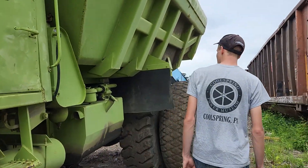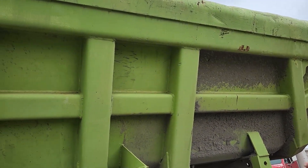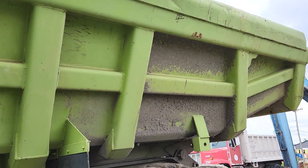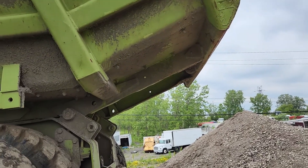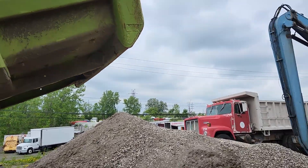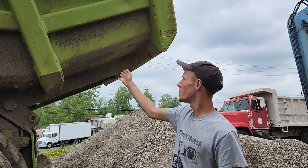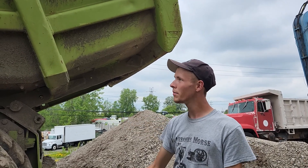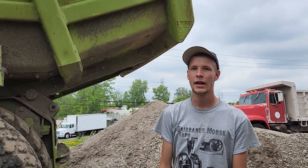When you come along the back, you can see your steel dump bed. It's got all these ribs attached there to help reinforce it. You can see that it goes up on an angle — a lot of dump trucks had that back then. They have a reinforcement plate; you can see the bolts. They sold reinforcement plates you could put along the back there, and it helped reinforce the bottom of these dump beds. That way, when you're dumping your material, over the years the erosion from material coming in and out of the back of the dump bed didn't erode it away. That was the big problem with dump trucks early on — the wear issues on the inside of these dump beds.